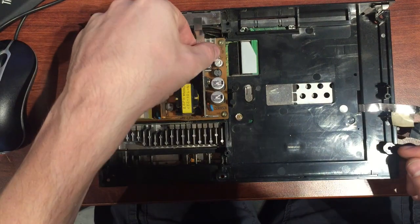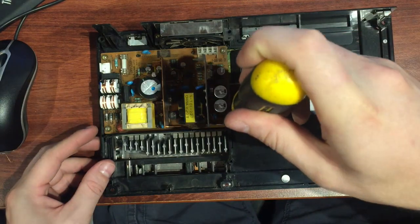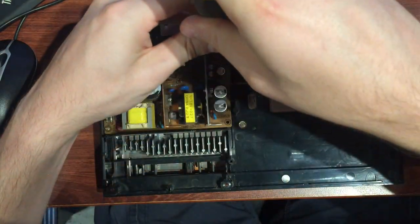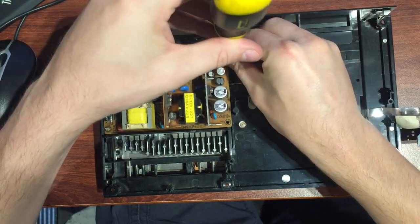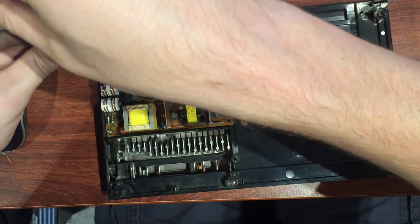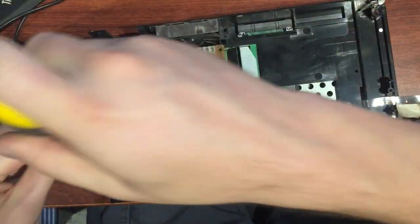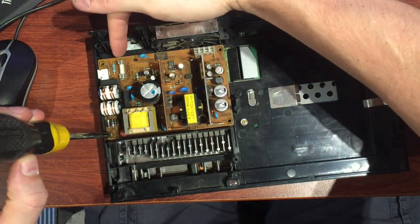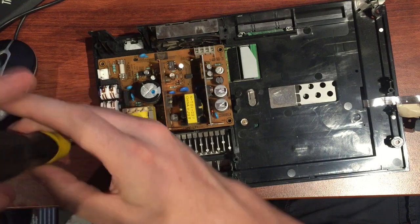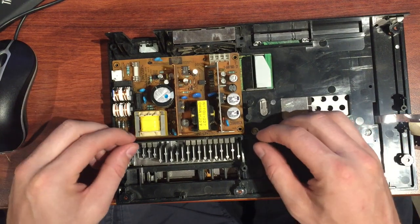We need to get this fan out — this little bridge piece of metal, just lift that off. Let's pull the power supply board out; looks like four screws around the edge. I'll put them aside because they're slightly different screws. If you had a completely dead PS2, I would suggest you look at that fuse right there — that little glass tube fuse — and replace that as necessary, as it would probably fix the power problem. In this case it's fine.